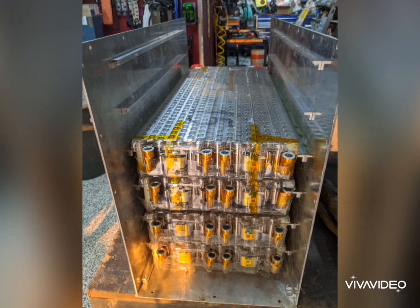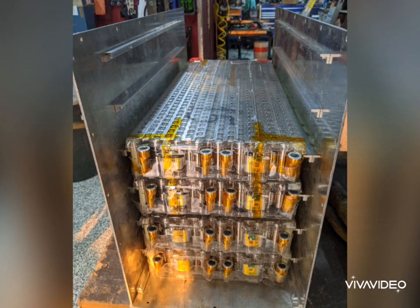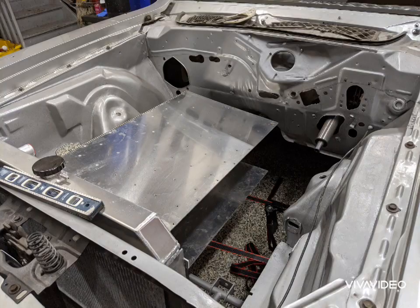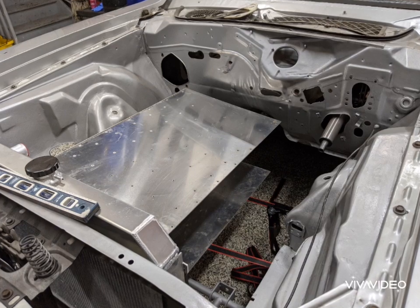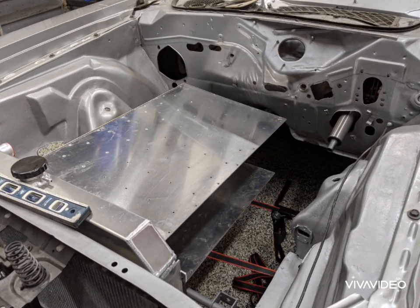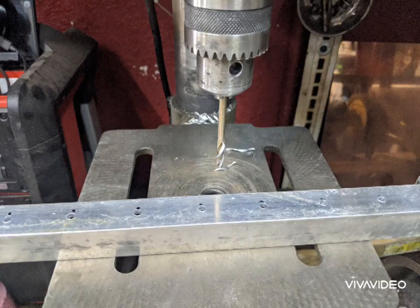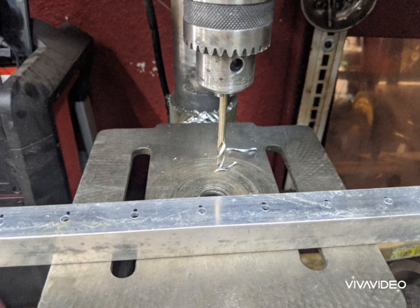Here's four of them stacked up. This is the coolant manifold side of the module — each battery module has two loops in and out, and they'll all be in parallel flow once assembled. I had to stack it on its side; originally I thought I would stack it vertical, but I couldn't fit as many modules that way.